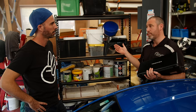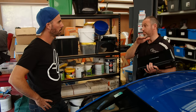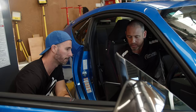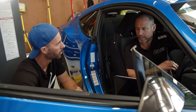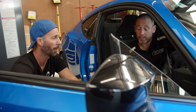Unequal length headers are not quite as good at the top end. Equal length headers still give you a torque dip, but they're better at the top end - the torque dip should be better in that 3,000 to 4,000 RPM range. We've checked that we can write data to the ECU. Is it possible the previous owner put headers on but didn't tune? Definitely - you'll still get gains from that without adjusting the tune, but you maximize it by tuning.